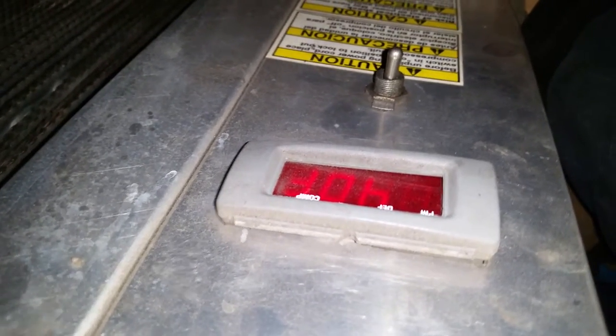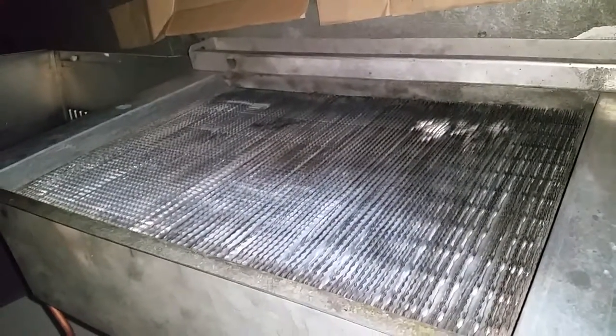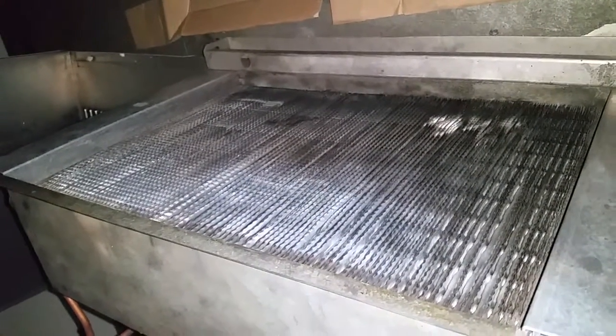The current temperature is 40 degrees right now. Here is the on/off switch. These are the condenser coils — I just did service on them, they were very dirty. That was the reason the condenser fan motor burned out. This is the compressor.